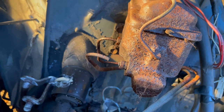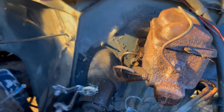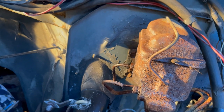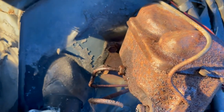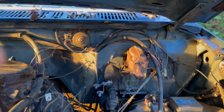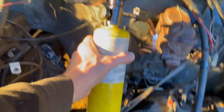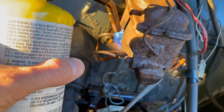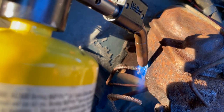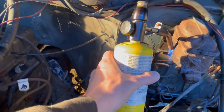So my experiment failed. I'm going to try it on the back one. I don't want to replace two lines - maybe I'll just re-flare this one rather than replace it. The back fitting is a little bigger so maybe it'll work better, and I'm also going to use the MAP gas because this propane's not working for me. Alright, now we're going to try it with the MAP gas - the MAP gas is way hotter.